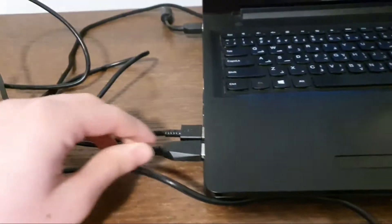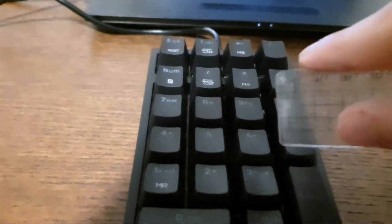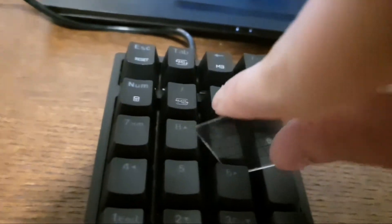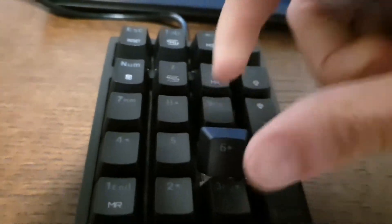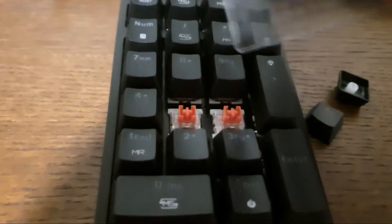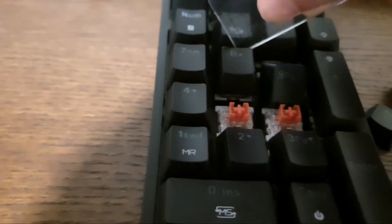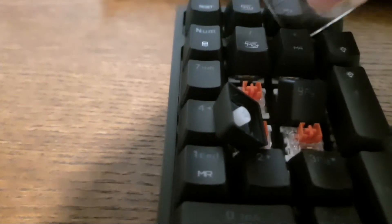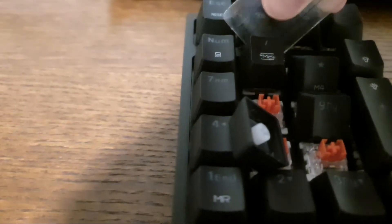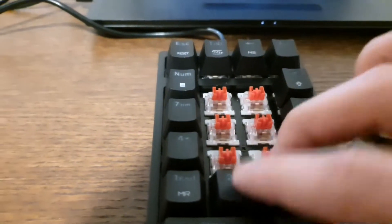So what you want to do to fix this is unplug your keyboard. This is going to work for all mechanical keyboards, not membrane keyboards, because they probably won't do this. I don't have a keycap remover, so you can use your fingers or a ruler to pop off the keycaps of the affected keys.